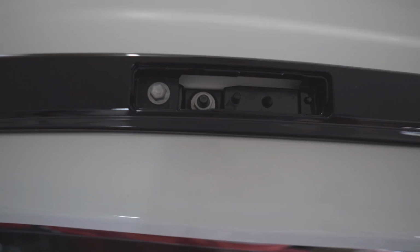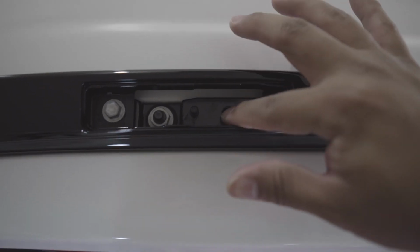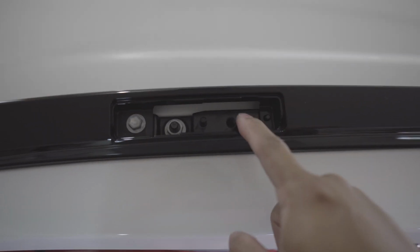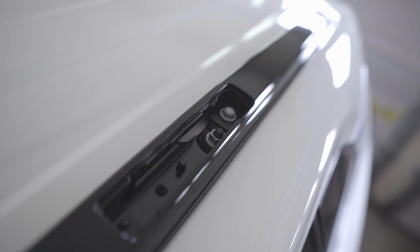Okay, so these are the mounting points. They are exposed now, and we can just screw the new crossbars onto this slot. Same thing there, and all 4 sides are removed. All right, so don't forget to put a cloth to protect your roof from possible scratches in case you accidentally drop your crossbars.